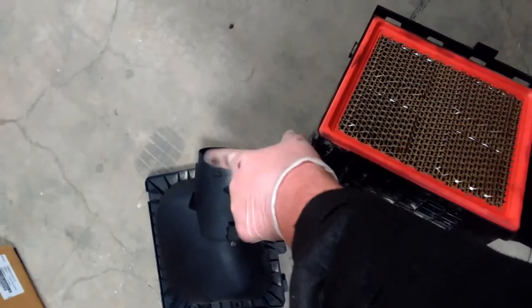First you want to take this whole unit out — it's a 13 millimeter right there. Disconnect those connectors, 8 millimeter hose there, get your air box out, and then you'll be looking at the alternator. We're going to go ahead and take the alternator off so you have a lot more room, and your water pump is sitting right there.